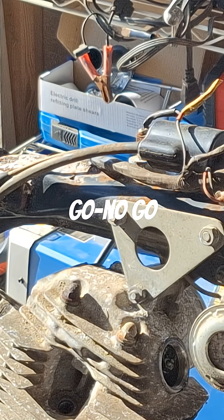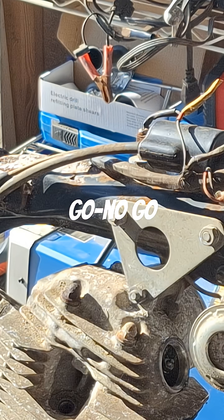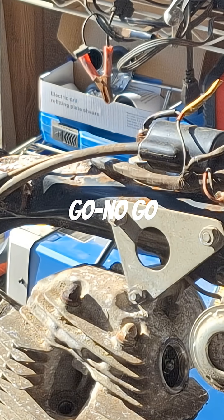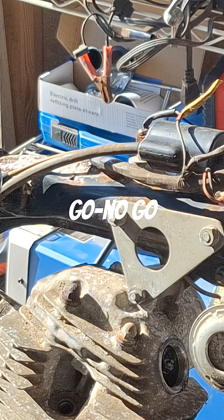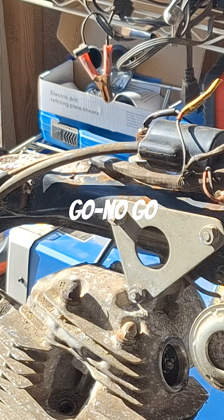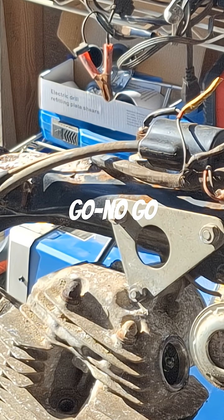So we're at two and a half thousandths on that exhaust — that's fine for this engine. Like I said, we're mainly worried about being too tight. It's usually what happens with the valve face. Let me see if I can show you on an actual valve what happens.